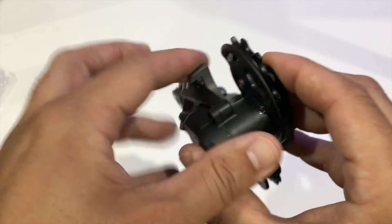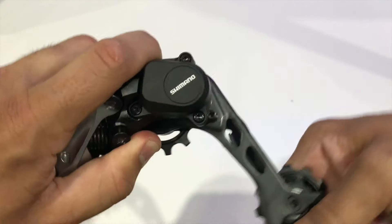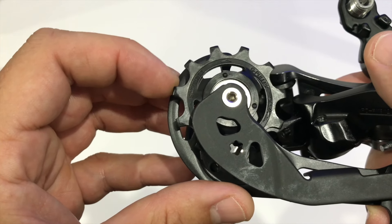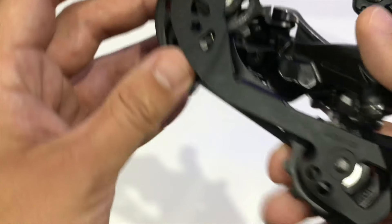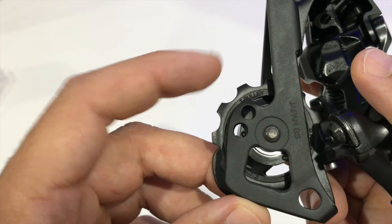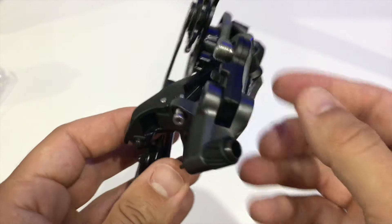On to the actual derailleur — first impressions are really good. There's plenty of that infamous fluorescent yellow Shimano grease. The clutch seems to operate fine — engaging it, it's really stiff, good quality. This is effectively the Ultegra level of the GRX, the 800 series. The jockey wheels have four bearings in them, so they're rotating relatively smoothly and freely compared to the bushed bearings you find on lower-end stuff. Ball bearing jockey wheels rather than just bushes is one of the big perks with higher-end Shimano. It's a Shadow Plus type derailleur.